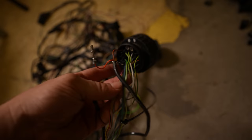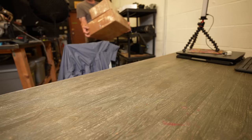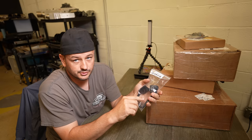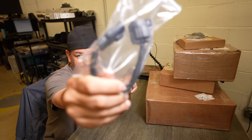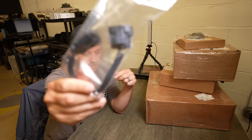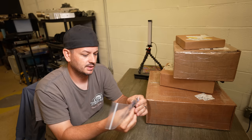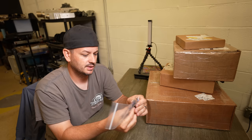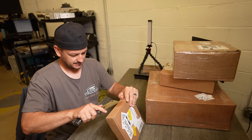Slowly figuring out what's what and de-pinning things as I go. Bunch of stuff came in - I don't remember what half of this stuff is. The throttle pedal in the car doesn't plug into the Holley harness; I was just going to get another pedal, but Current Performance sells this adapter that just plugs right in. I still don't like the placement of the pedal, so I'll fix that later. Also from Current Performance, I got a bunch of pigtails for the GM stuff that's not actually part of the engine harness - like starter signal, alternator, and AC. Handy to have.